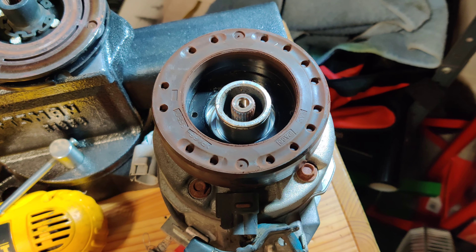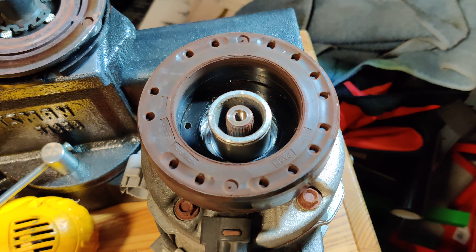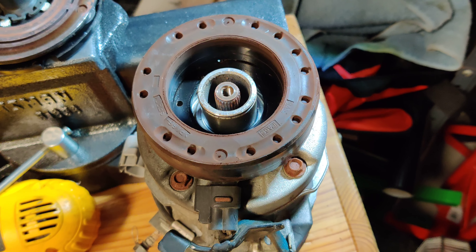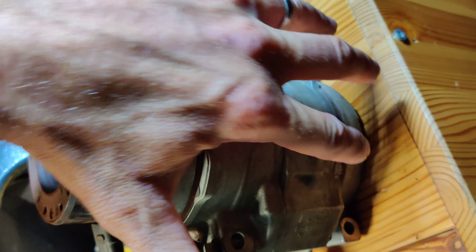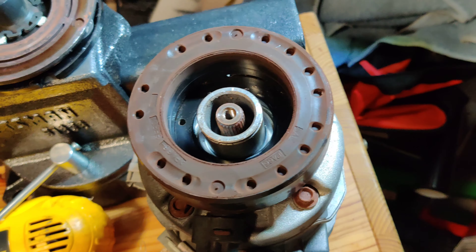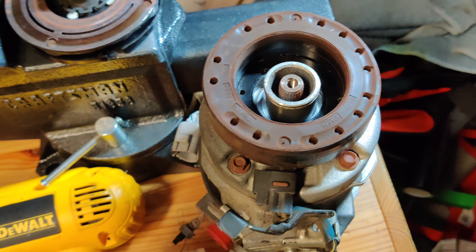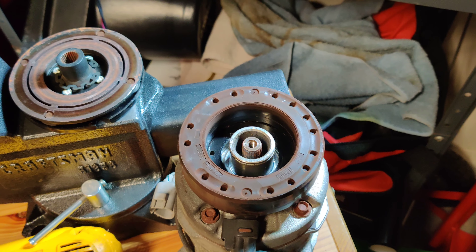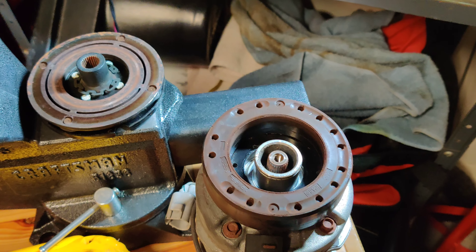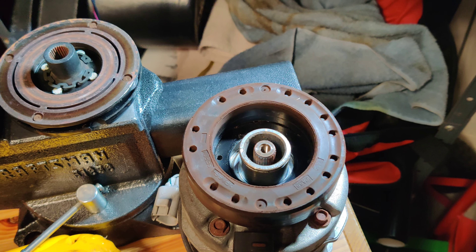I'm going to make another video in succession to this showing how to do this when the compressor is on the car — it'll be a 2002 Lexus ES300. The steps will involve taking off the serpentine belt and whatever's in the way; the alternator will have to come off. There are four mount bolts holding these compressors on — take those out and you should have enough swing in the rubber pressure lines to get the compressor oriented to do this work. This will apply to many different types of compressors — pretty much except for GM, they do things the hard way. If you have any questions, let me know. Thank you.